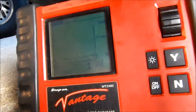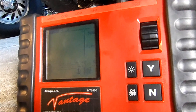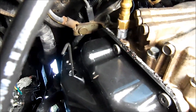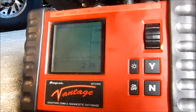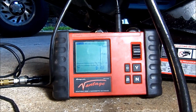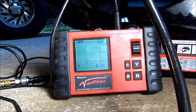We have one pound of pressure, that's all we got right now. We are connected and I already have my Allen wrench here ready. We're going to let the fast idle come down and then try to adjust this SLT solenoid. The foundation pan is already installed. We are doing our SLT pressure calibration, minimum five pounds. We are at one pound, and one click equals one pound, so we're going to go four clicks and see if we can bring it up to five pounds.